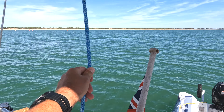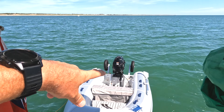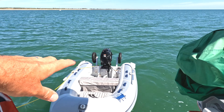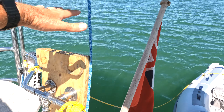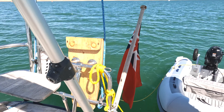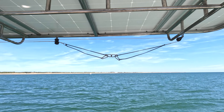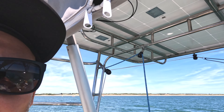We've got a separate blue line which allows me to lift the outboard off the back as well. That outboard is the best part of 50 kilograms, so it's tricky for someone to lift. But it's got a strap on the top — we hook this line on it and then lift it up and put it on here just using the electric winch, which takes all the strain out of it. That's the kind of multi-purpose arch we've got on the back of the boat.